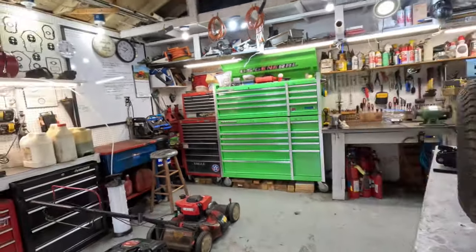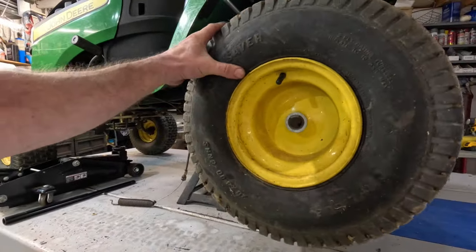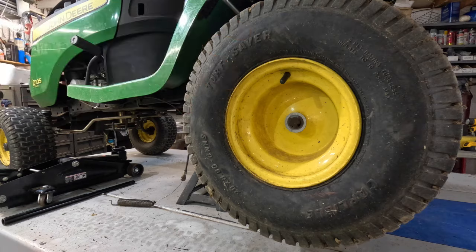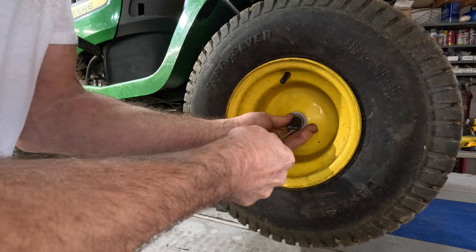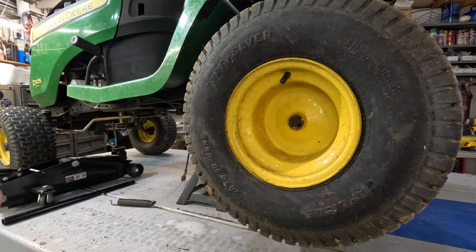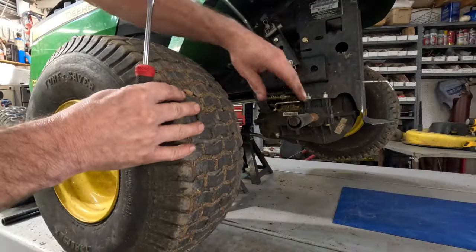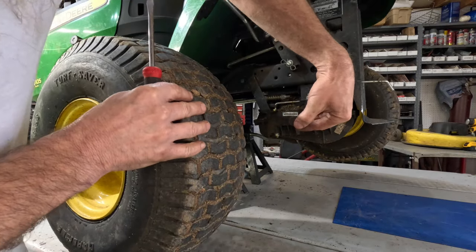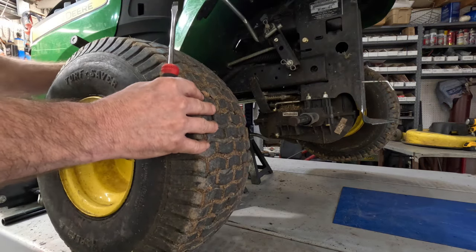Whew. I'm gonna go ahead and pull these back wheels off. That gives me more room to get my arms in there. And like I said, he's missing his dust caps, which will cause that shaft to seize to your wheel, and you'll never be able to get the wheel off if you don't. I'll keep them dust caps on there. This is where you lose an E-clip. Haha, I got it. I gotta make sure I put some dust caps on there and make sure you don't lose this key right here. Without that key, you just got a shopping cart. That's all it's good for.